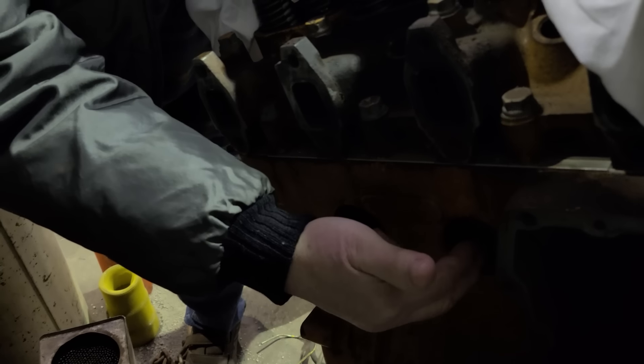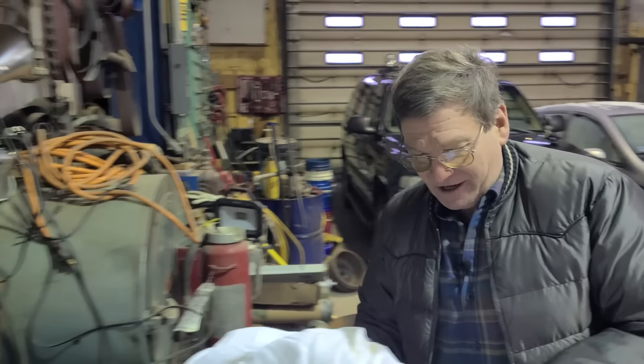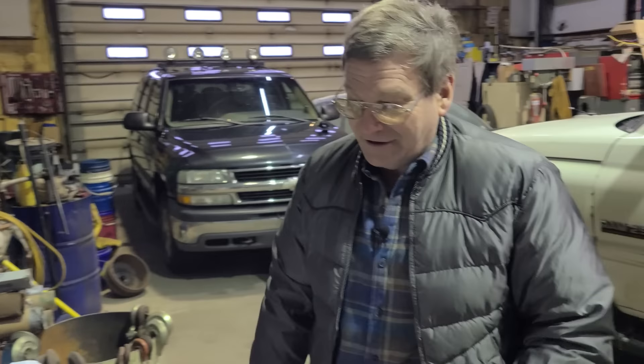Some engines, even if it's in between bores, there's not enough room to get the heater in. If I have my choice on a V8, put one on each side — don't just do one side and leave the other side cold. It'll start probably on the four, but it's better to start with all eight of them warm. Be nice to it, heat up both sides.